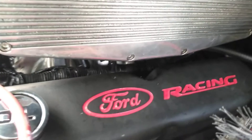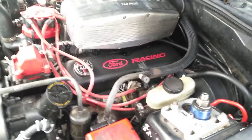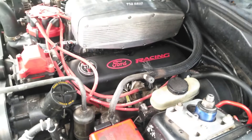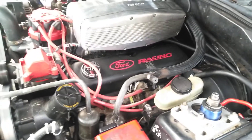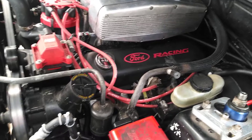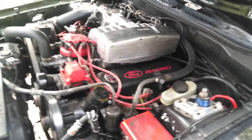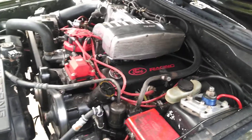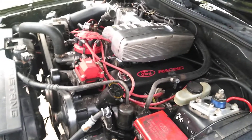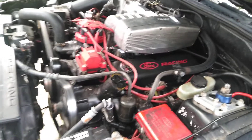I am sure there is a leak under this intake — it's leaking. I do still have the wide open throttle issue, the backfire when I give it gas. It's slightly better because when you give it gas now, it misfires and then it will continue to go. The last time it would misfire and not go at all — you actually had to lower the pedal to get it to go again. Now if you barely hit the pedal it will go fine through all the gears, but the moment you start hitting the pedal hard it starts to want to misfire.